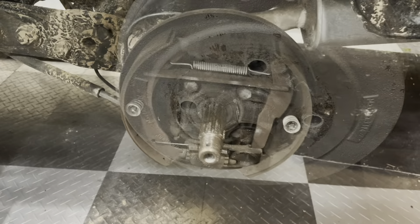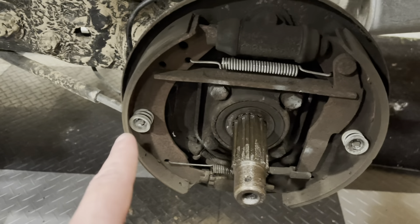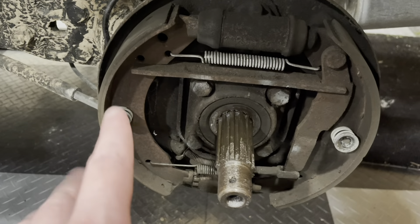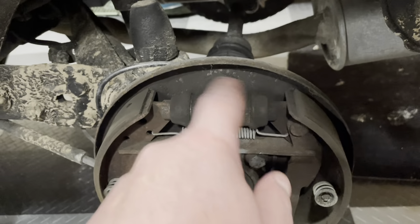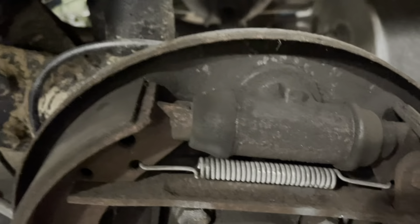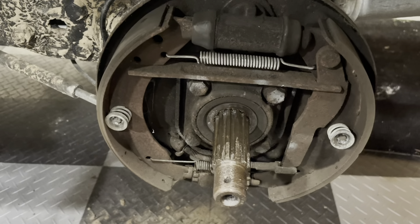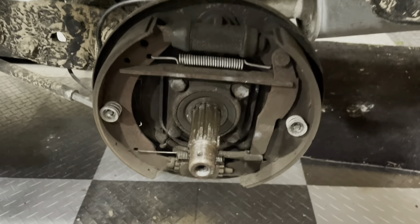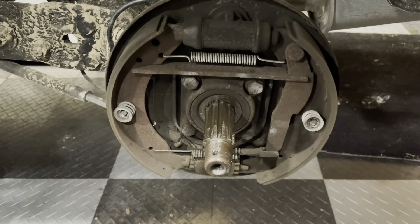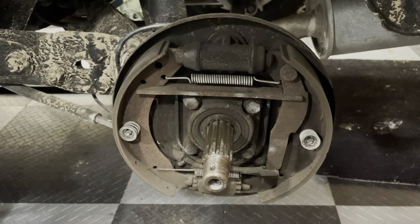The disc is off and the thread is okay — I didn't damage it, which I'm very happy about. I'm going to take apart the whole drum brake system. I've got new springs, new brake shoes, and a new brake drum on order. The brake cylinder looks actually okay — the previous owner told me these have been rebuilt, and looking at the condition of the springs and brake shoes I'm tempted to believe them. But that brake drum says 'Made in West Germany,' and West Germany hasn't existed for going on 30 years, so I know those drums are old. Let me get this off and we'll be one step closer to the wheel bearing.